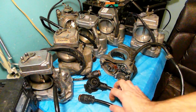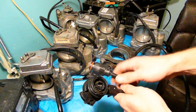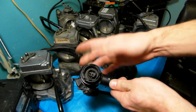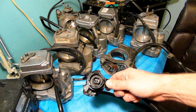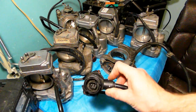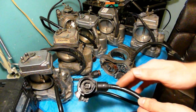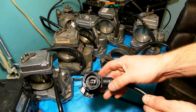The biggest difference between throttle bodies made in 92-93 and later ones is the connector. We have a big round plug with a spring-loaded mechanism on top of it — you can actually see the spring right there. This unit you will find in 92 and 93 models: 400SE, 400SEL, and 500SEL. This is a rare older style unit, one of the first ones that Mercedes made.